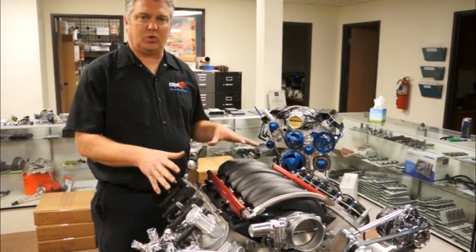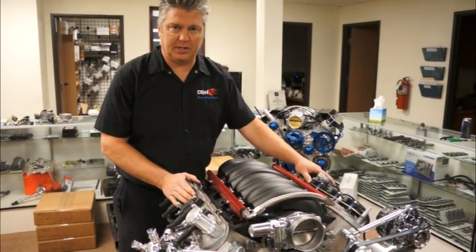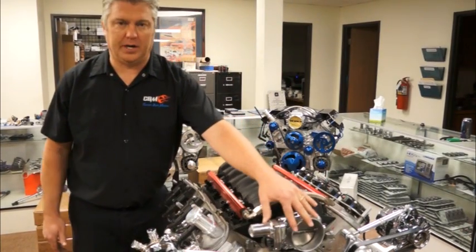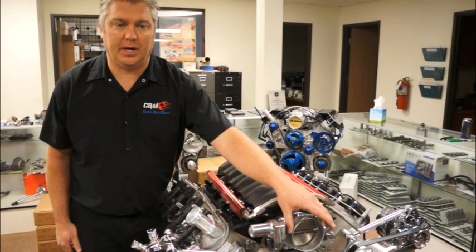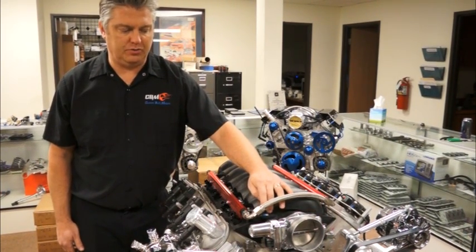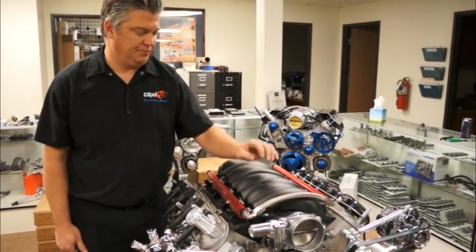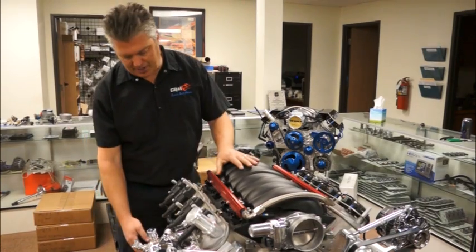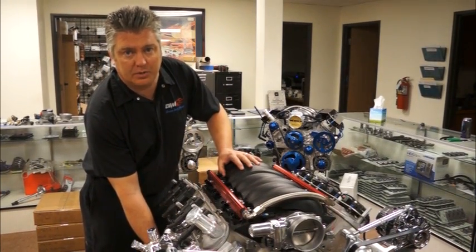To answer some of your questions on the engine here, basically you're going to have eight coil packs — four on one side, four on the other. You have the throttle body. Your mass air flow sensor would be mounted to your throttle body, as well as your MAP sensor, which is going to be mounted either on the front side of the intake manifold or on the back side of the engine. Down on the side of the engine, behind where the starter would be located, you're going to find your crank sensor.